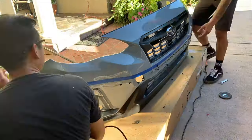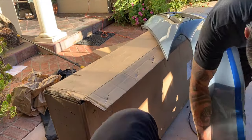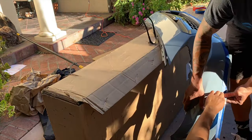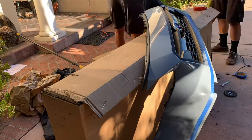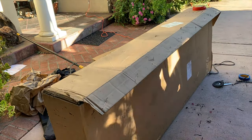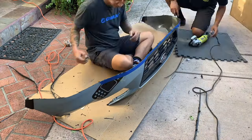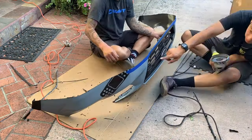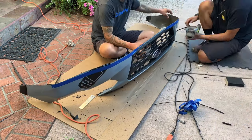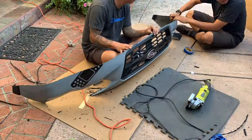This is probably the trickiest part of the install — cutting the bumper. You're going to want to go really slow, measuring multiple times to make sure your cut goes well. You can use an angle grinder or whatever method you prefer for cutting plastic. It's a little quicker but the plastic does melt and get really hot, so be careful not to go too slow. We did this probably about six times — took it off, cut it, took it off, cut it again — until we got the proper fitment.